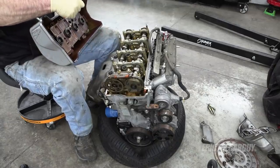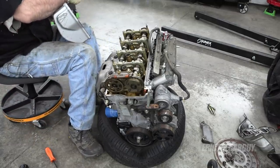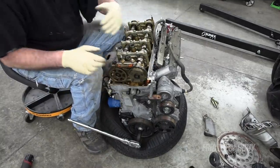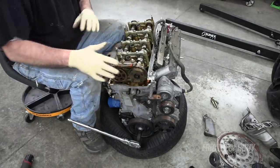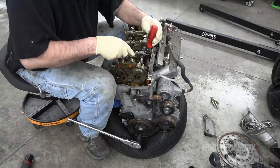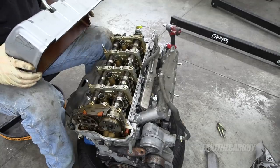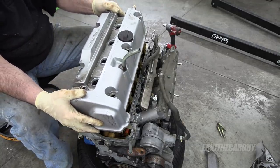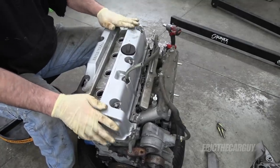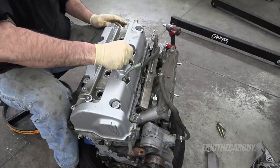I guess they broke the dipstick off, but this looks very, very clean and very nice. These particular engines only have the VTEC on the intake side, but they do have the adjustable cam gear so that it can change cam timing. Those are going to be eight on the intakes and tens on the exhaust. With that sorted, I'm going to put the old valve cover back on to avoid any damage or issues with the new paint that I put on the other valve cover. I'm really just putting this on here to seal things up — I'm not even really going to tighten these down, just keep them snug. I'm also going to put the plugs back in.